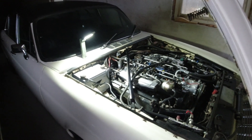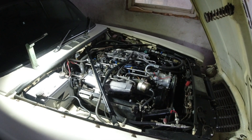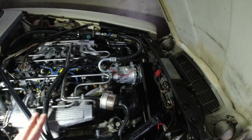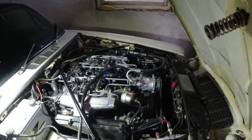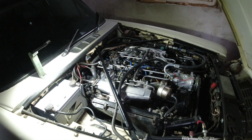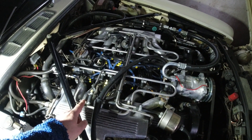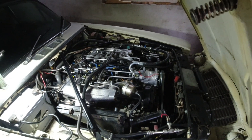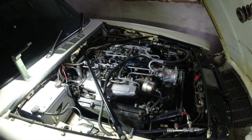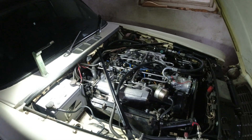I managed to find a couple of minutes when it's not raining. The battery's been on charge and it's a lot drier in here — we don't have any condensation on the engine this time. The dehumidifier is working overtime; it's actually keeping it pretty dry in here. I've also unplugged the cold start injectors in case one of them is sticking and flooding it. Battery's on charge — let's give it another try, because this time I can actually hear if the fuel pump is doing anything. Before, it was raining so hard I only heard the relay click but didn't actually hear the pump.